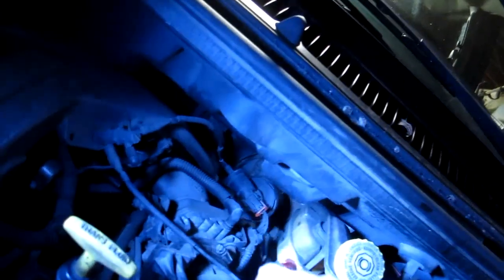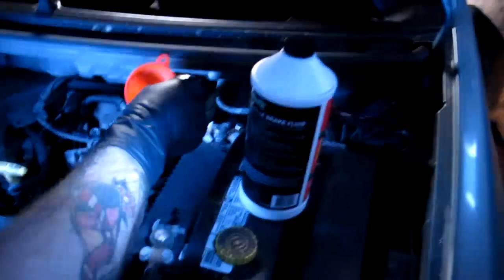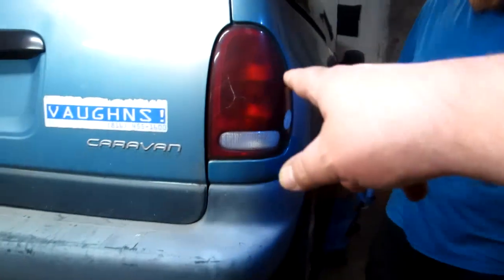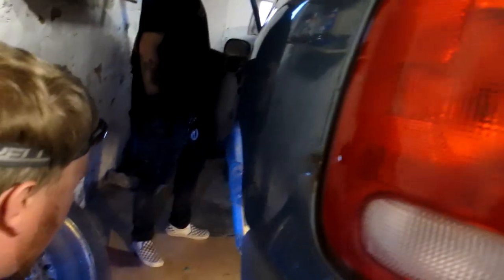Fill it up — we've got to bleed these backs. So you put the flashlight up to it — it looks pretty empty. Since the van is tilted up with the rear end sticking way up, it's going to be harder to fill. Just put a little bit more in there because we're going to have to bleed it. All right, bleeding the brakes — start it up and pump it three times and hold. One, two, three, hold. We need to get all the air out. Hit the brake, hold it — go spin the other side.